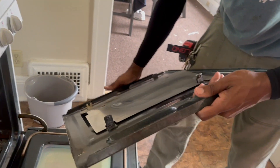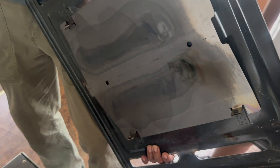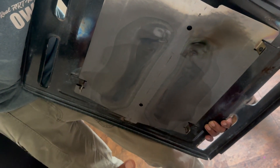The shield here — I'm going to put this back on there. It might be air still in the line. With this shield right here it'll do the same thing as the burner caps. The gas comes out, hits the shield, and the little glow rod lights it — and that's pretty much how your oven heats up. The fire sits right here and the heat goes through the whole oven.